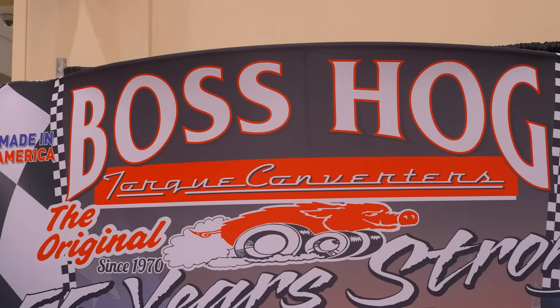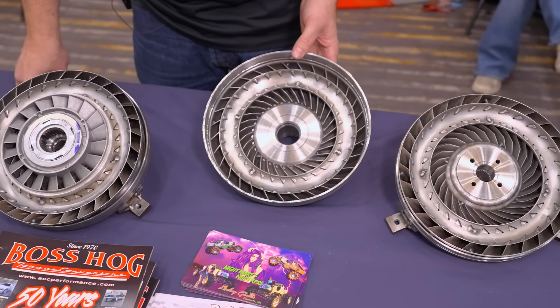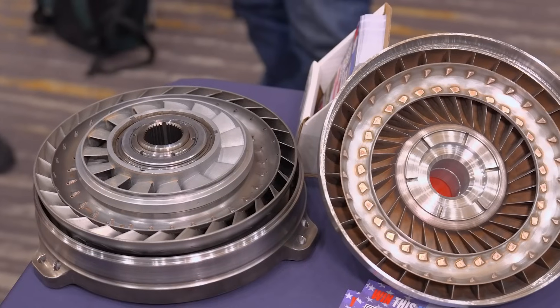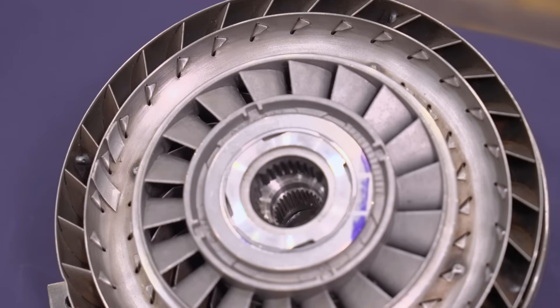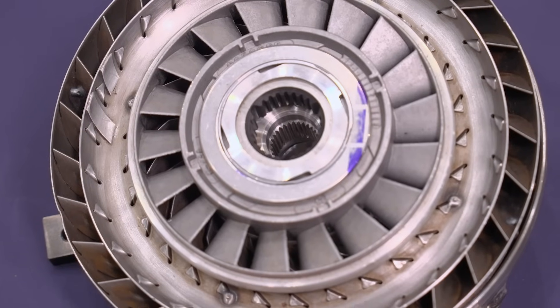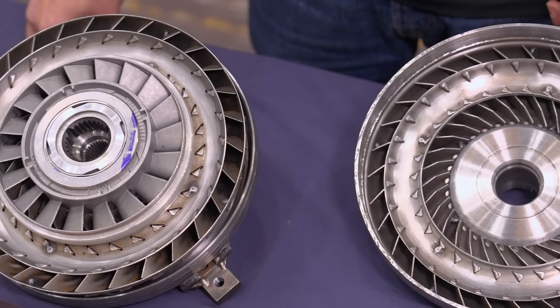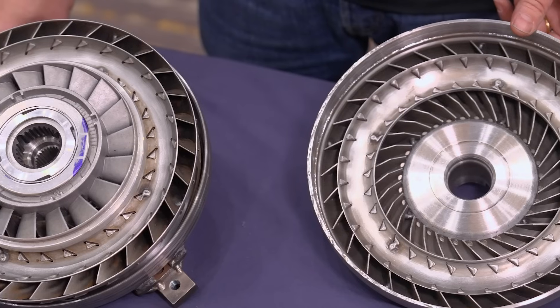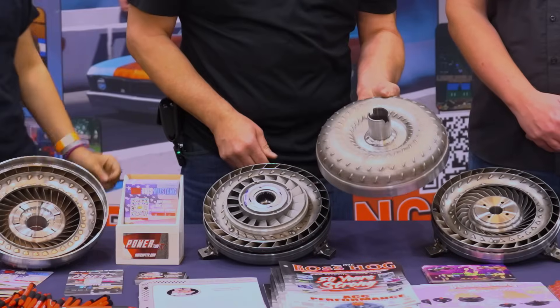So you can make that 200 and 700R4 match the actual LS engine. What we've done is come up with custom front covers — you'll have the spacing for the 200 and 700R4 transmissions. And we've gone beyond that — the Turbo 350s, 400s, and Powerglides will fit the LS engines as well. It has the bolt circle for the LS and we've got the crankshaft pilots to match.